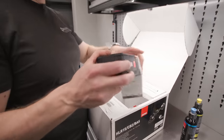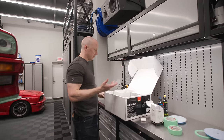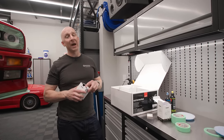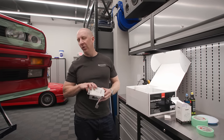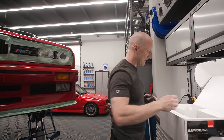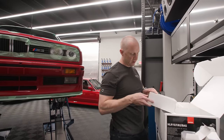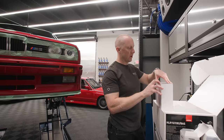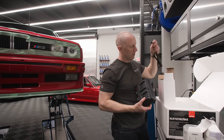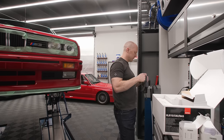What I normally would do - which is what I'm doing now - is tape the car up. If you didn't watch the decon series, my preference is to decon the night before or the day before and let the car fully dry. Then I can come and tape. It also helps with the fatigue. You can use compressed air and blow out all the cracks and crevices, but I find it's easier to just let the thing sit and dry off.